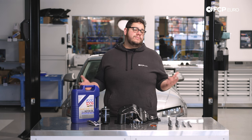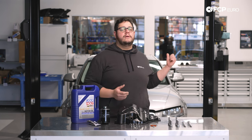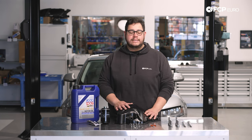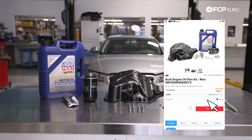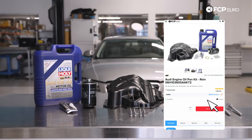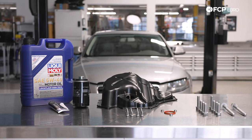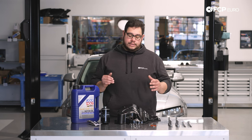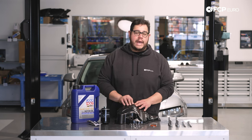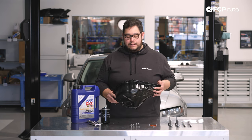This is going to be applicable to most cars with the two-liter turbo. The weight of the engine placement on your vehicle may be a little bit different than what we're working on today, but the general idea will be the same. The kit we have in front of us is available on fcpeuro.com. It includes the new pan, the hardware, a couple seals, the gasket maker — we're using the Permatex Ultra Black — and an oil change kit as well. If you're not going to be replacing your pan, you can still use most of the hardware out of this kit. Just be sure to add a drain plug. Our new pan already comes with a drain plug installed, so we do not need to get one separately.